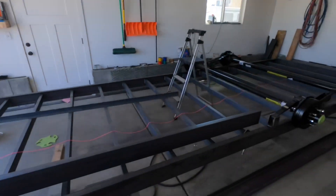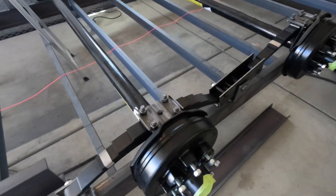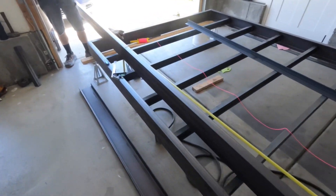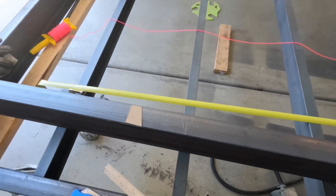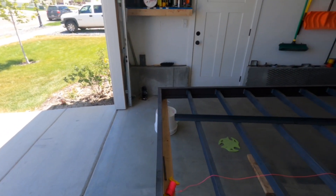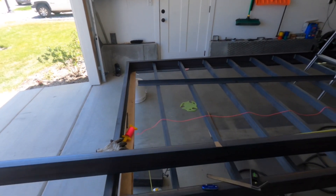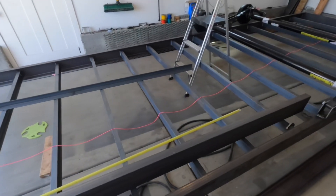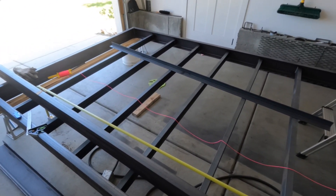We're back. I got help for the tongue because these pieces are heavy. I got my suspension all torqued, everything's pressed in, it's done, it's looking good. I got these all measured out - we're gonna make the band at 90 inches. I figured the angle out. This should stick out past the front of the deck 40 inches, and then with my channel coupler there should be another eight inches, so we should have four feet of tongue sticking out. That'll leave plenty of room for a jack and a box and all sorts of stuff.